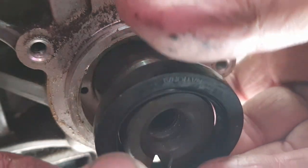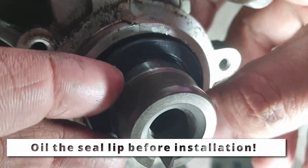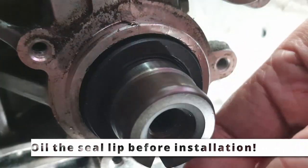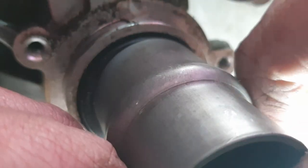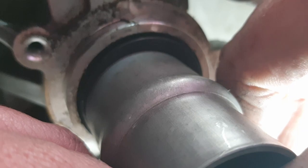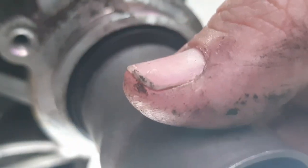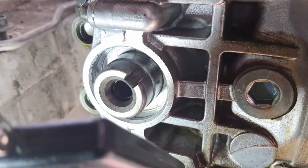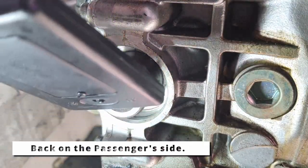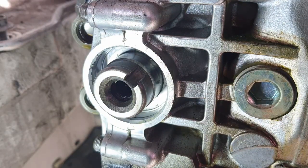Okay. So, slide this seal over that, just sort of wiggle it on down a little bit, and I'm going to take my DIY driving tool. For now, I'm just going to rock it on over that, squish it in there. And from here on, I'm going to use a rubber mallet to gently drive that home. Make sure I don't have any big boogers in there, or rocks, or sticks. Nothing got in there.